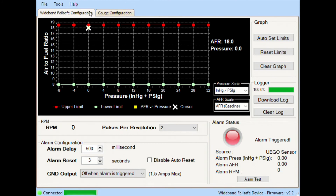In the other display tab you can set up the graph for readings and also configure the RPM. For this car the RPM signal is at two pulses per revolution. I'll start the car up so you can see what happens. She idles a little low when she's cold, but you can see everything seems to be working — it's reading AFRs, it's reading RPM. More or less, this is what you should see.